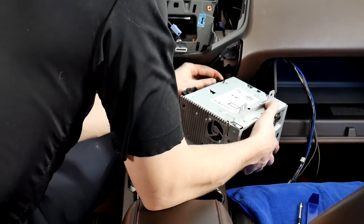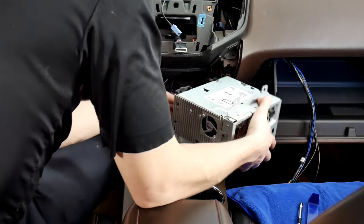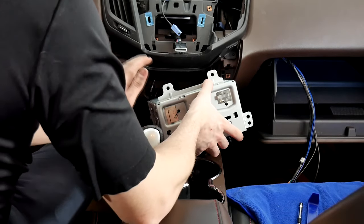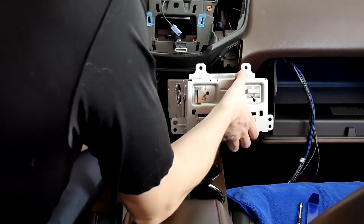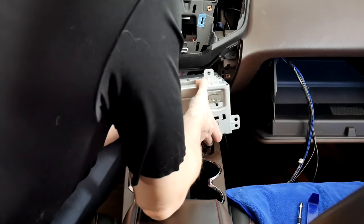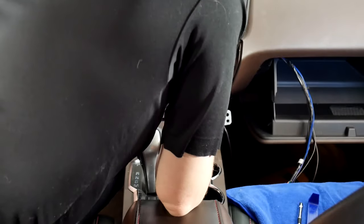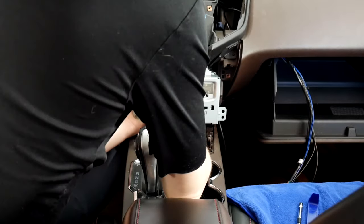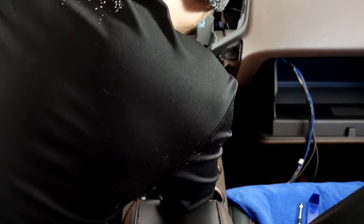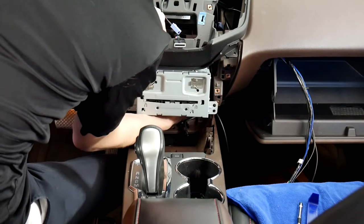Now let's finish plugging in the antennas — they're all color-coded except for this yellow one, which goes on the regular metal plug. The next step is a little bit trickier; there's not a lot of room behind this radio. Using that hole we've been running everything through, pick up a lot of these wires and make sure they're running back there with their slack — we don't want any slack behind the radio itself and we don't want any plugs behind it either. The bigger black plug is a little harder to get back there but it will go along with the rest of the harness. The only thing behind the radio right now should be just a little bit of cabling.